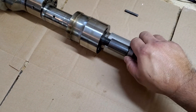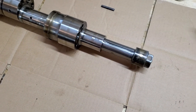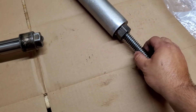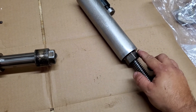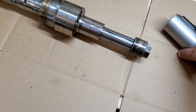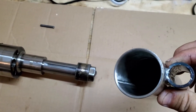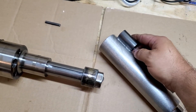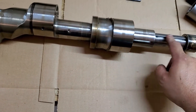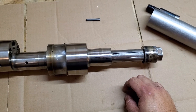That's all it is for the 20B eccentric shaft — separating the hub. I've seen other people try to use pry bars and all that, but this is the right way to do it. Get yourself one of these or build one — use good threads, weld a nut on, and it's about an inch and three-quarters pipe. The threads on this are really strong. Also note there's a keyway in the front, one in the back — three keyways total on the 20B e-shaft. Thanks for watching, like and subscribe.